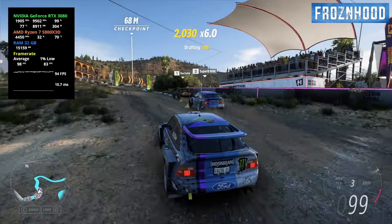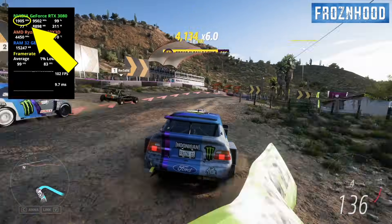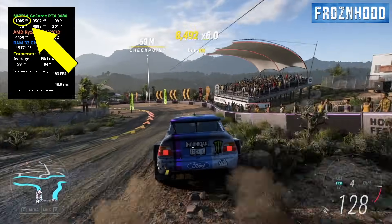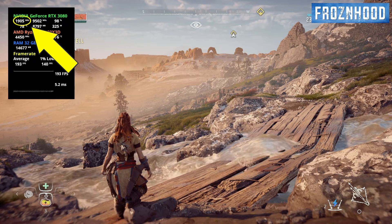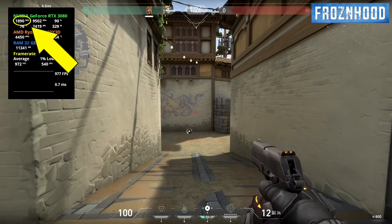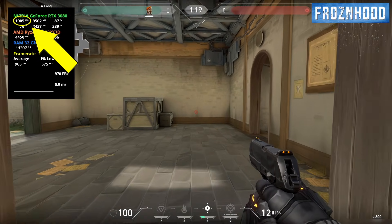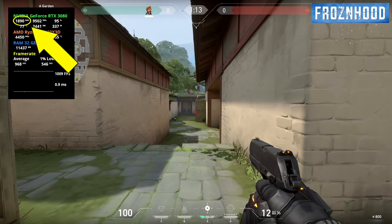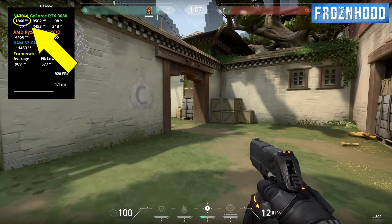Start your favorite games and check the average frequency that your GPU is keeping during gameplay. Different games stress the GPU differently, so the frequency may vary. You need an overlay to observe the frequency — you can use MSI Afterburner or the statistics overlay that the Nvidia app provides. In Forza Horizon, my GPU is keeping a stable 1905 MHz; same frequency in Horizon Zero Dawn. In Valorant, it goes slightly below that in some cases. So the undervolting should target a frequency around 1900 MHz for my GPU, but with much lower voltage and power consumption. The frequency target for your model may be different — write it down, because you will need it later.